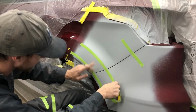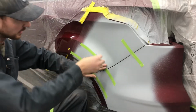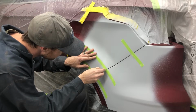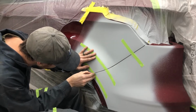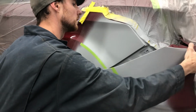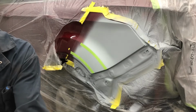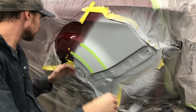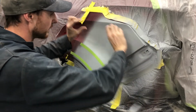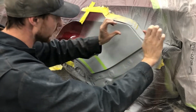And this body line on the bumper actually doesn't go very far, just kind of like so. And now I'm just going to take a razor blade. Separate like so. So I'll set this guy aside now and get blocking on the body. And again, we're going to use my variety of blocks. And again, using that 45-degree, well, roughly 35-40 degree one direction, and then 35-40 degree in the other direction.